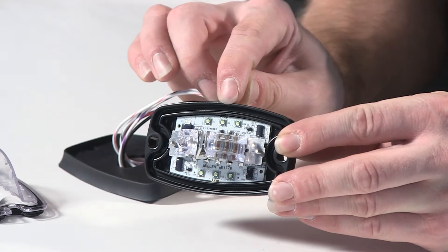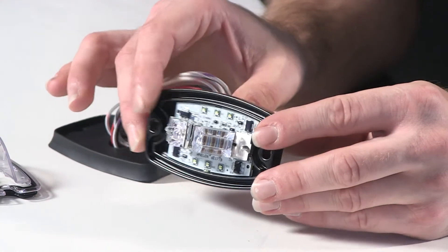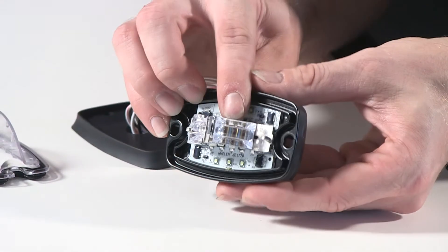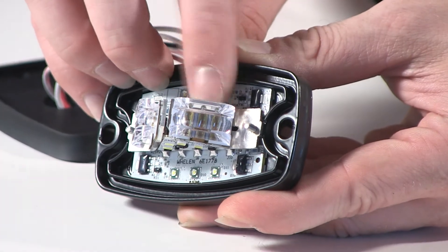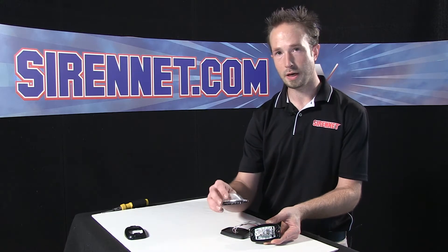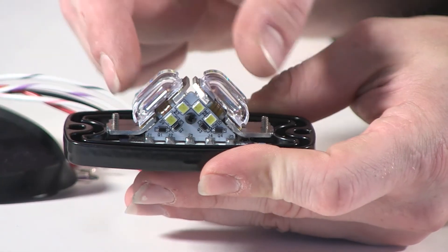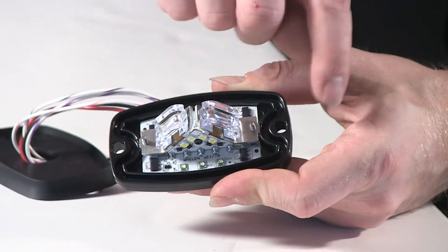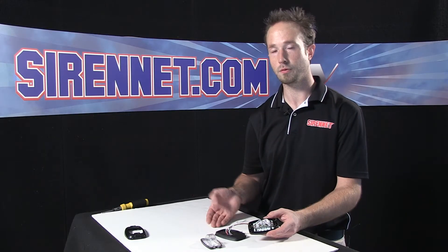Also inside the V-Series, in addition to the three diodes on the top and bottom acting as a takedown or alley spotlight, you have two sections that are your warning diodes — three diodes in each section. They are small but highly potent diodes, especially with this patented diffuser that Whelen puts over them. That helps to spread the light from the three diodes to give a nice fill in the 180-degree output the V-Series offers. So these two sections give you 180 degrees, with reflector assemblies spreading light all the way across — very nice for emergency vehicles, both big and small.